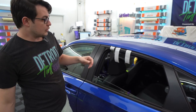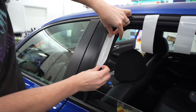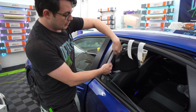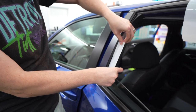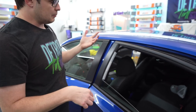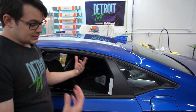The reason I cut off multiple pieces is it's just easier to layer inside the seal. All I'm covering is right in here. I push it in as far as I can get it and then wrap it around the paint portion — open the door up just a little bit and wrap this around the inside of the paint there. A lot of paneling will not be paint; it'll be plastic along with maybe rubber or felt gaskets. This is a little trick that helps keep a much cleaner tint job on any type of car. I tinted for plenty of years without taping anything, and now I tape literally everything.